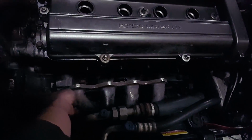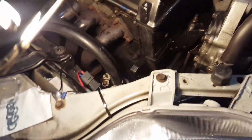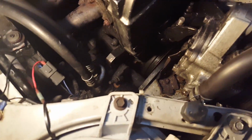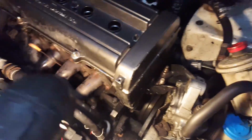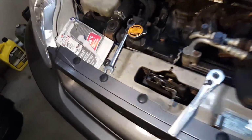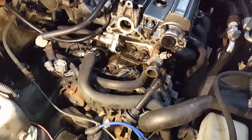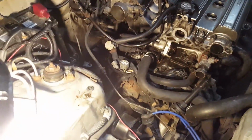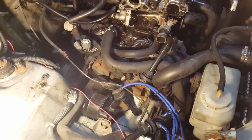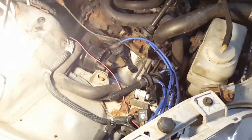And I guess I should have specified what I'm going to do next. I am going to put this exhaust manifold on. The exhaust manifold's bolted back up. Now we're just going to come over here, put the AC pulley and belt back on and the power steering stuff back together. Just button this whole side up. Okay, we got this side of the motor bolted up. Now really the only thing left to do is to put the hoses back here, plug this stuff in over there, and then pop the distributor on and plug in the spark plug wires and put the airbox back in. And I'm going to go ahead and do all of that really quick.